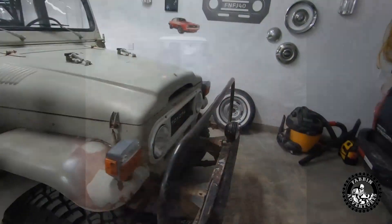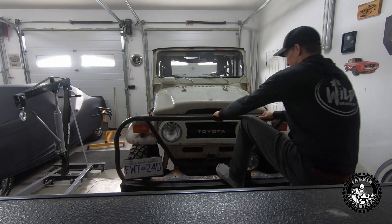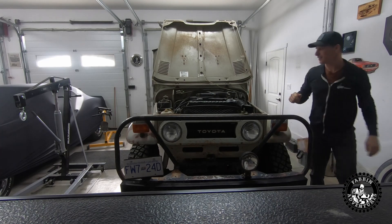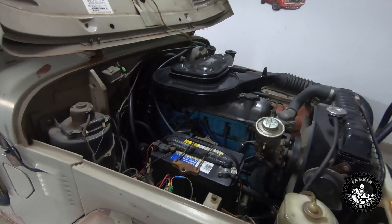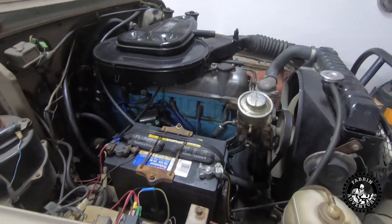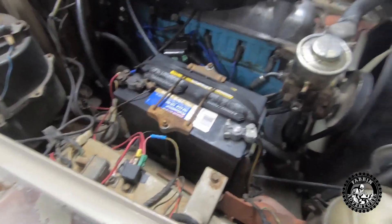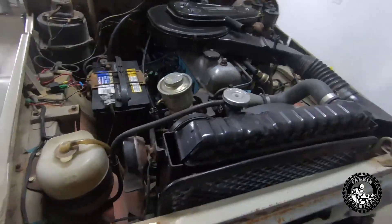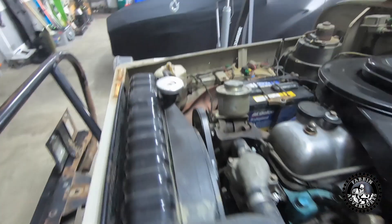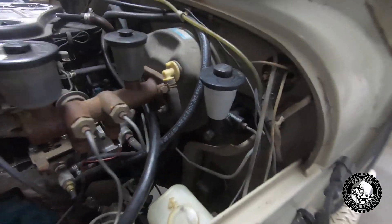I popped the hood here for you so we can take a quick look under the hood and see what I did for the engine. The hood's out of alignment a bit so I have to crawl up here to give her a good pull as I open it up. The nicest thing about working on these and the old CJs is just right to the back — it's great. So I completely rebuilt the motor. I painted the block a light blue — that's not stock but it helps to capture any leaks. I put in an HEI distributor instead of the old points and electronic ignition it had originally. I also put in power steering, and in order to do that I had to relocate the alternator down here because the power steering pump is mounted where the alternator was. New rad, new master cylinder for the brakes, and new master cylinder for the clutch — I just did that the other day.